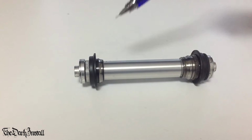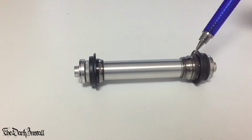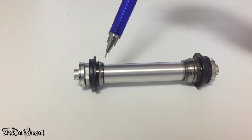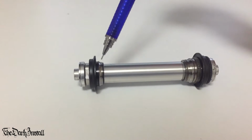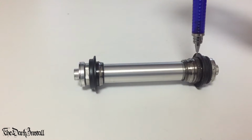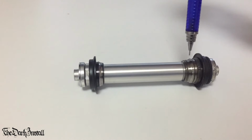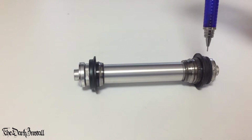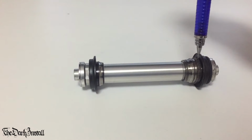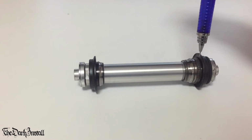This is a standard locating and non-locating bearing arrangement system. This side is non-adjustable and sits into the bearings, which are open cup and ball inside the hub shell. This side, this part here can screw in or out, so that's the preload adjustment. This plastic part is a very clever system. It slides on to this spline here. Now this spline also acts as the gripping part of the preload system, so you can screw it in easily.